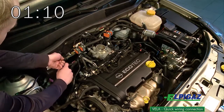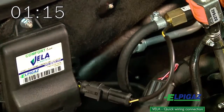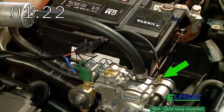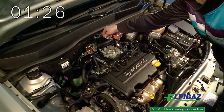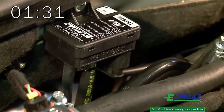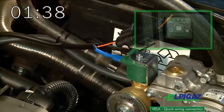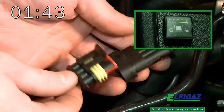The system is equipped with its own sensors: temperatures of gas on the gas injectors, gas reducer temperature, gas pressure, and manifold absolute pressure in the intake manifold. The power supply and ground of the coil are used to control the gas supply to the reducer. The petrol gas switch is connected to the main harness with the appropriate hermetic connector.